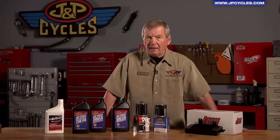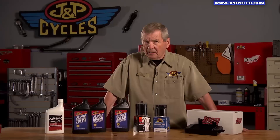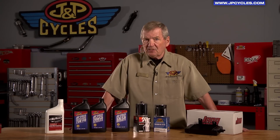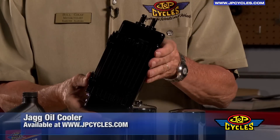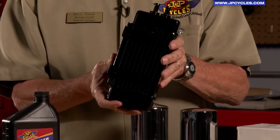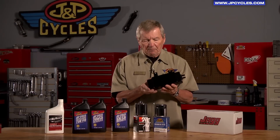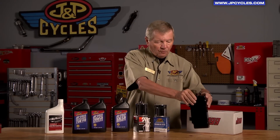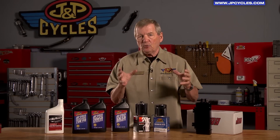All of the new Harley-Davidson Touring motorcycles come today with an oil cooler, and particularly for customers who live in the warmer climates — Southern California, Arizona, Nevada, Texas — an oil cooler can be one of the best forms of insurance you'll ever put on a motorcycle engine. This particular one is a Jag cooler. We carry the entire line of Jag coolers. This particular one is a frame mount — oil in, oil out — and reduces the temperature of the oil by some 15%. Jag does have a new product that you'll find in our catalog: a thermostatically controlled fan-driven oil cooler.